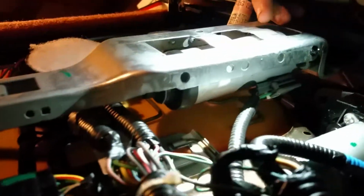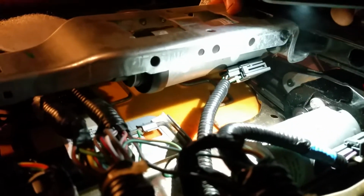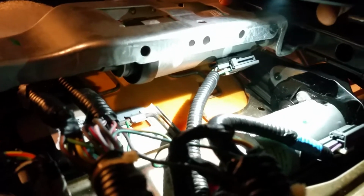And then we started with the track motor. The motor here, it's hard to see, I don't have any light, but there's 3 motors here, and then another one that does the back. And yeah, here's the light. So 2 of them were sensors. This has memory, so there's position sensors, and 2 of them aren't needed unless you're doing memory. And so we found it's going to be your 2 biggest wires on each motor. 2 of them are bigger than the other 2. Like this orange, green with an orange stripe, that's a ground. They're all ran together. That's for the memory. You don't need them unless you know them. So we didn't hook it up. We left them there though, intact. I could come back and add memory later if I wanted to.